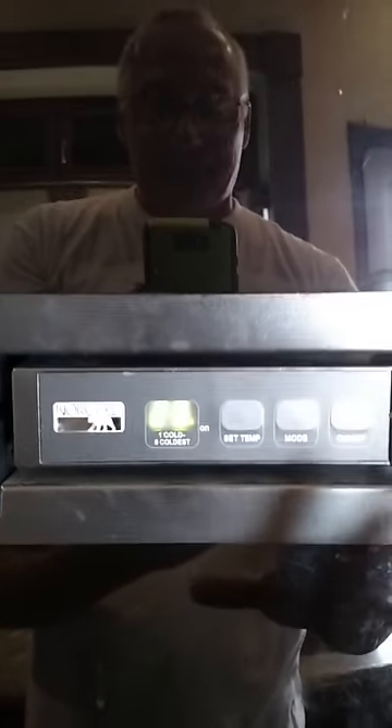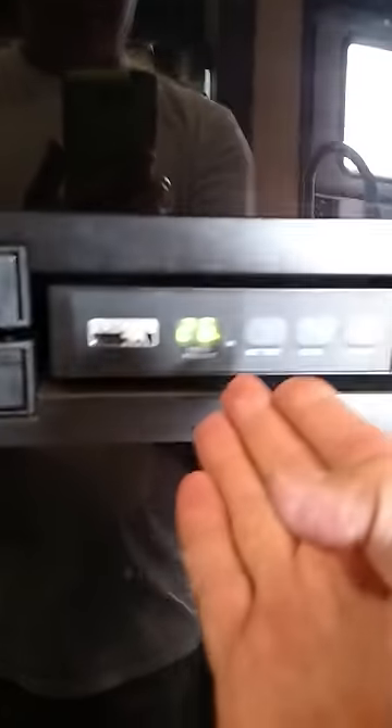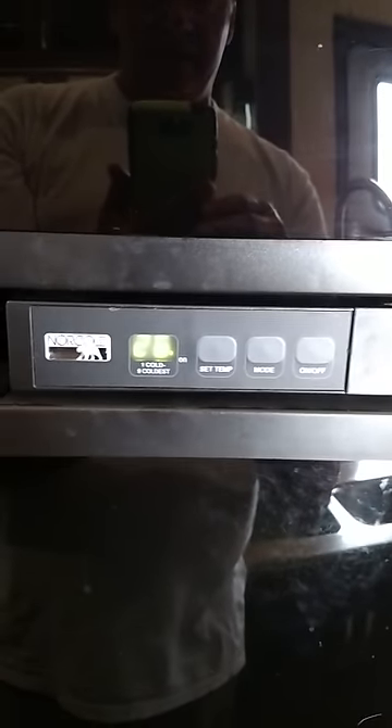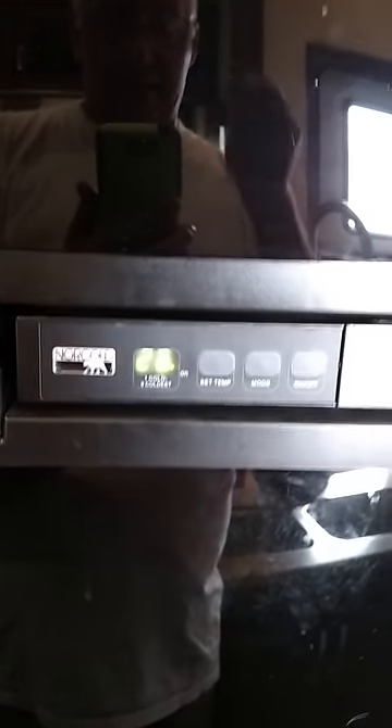And it's worked every single time. I'm not sure if there are error codes — I don't know how it fixes it. These refrigerators are a little like voodoo. The other thing is, make sure that these doors are closed all the way — they're snapped closed. If somebody just goes like this, it may start beeping in two minutes. Even if it's partly closed, I don't even trust that. I push here and make sure they are both closed tight, because that could be all that's driving your temperature up. Good luck and thanks for watching — I'll include a link to the PDF file that shows these instructions in text.